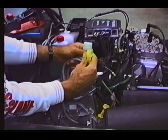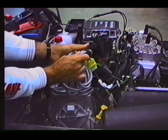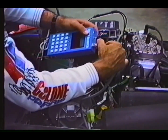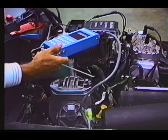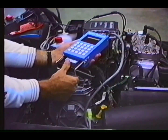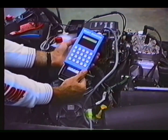Install the select monitor service harness and cartridge as will be shown. For 1993, the method for powering up the EFI system has changed. 1992 models required that we turn the ignition key to a spring-loaded start position. This start position would power up the EFI unit and turn on a green ready light. This year's EFI 500s do not have the ready light or spring-loaded key switch.